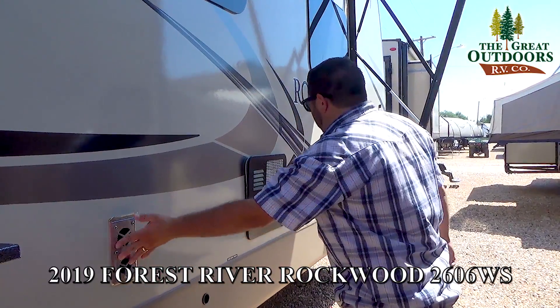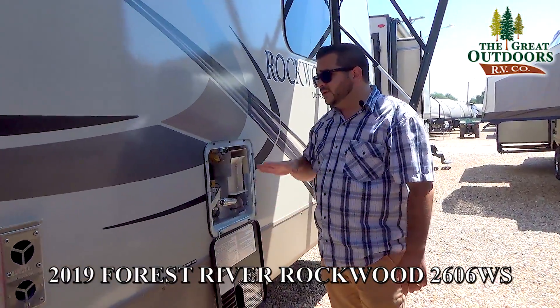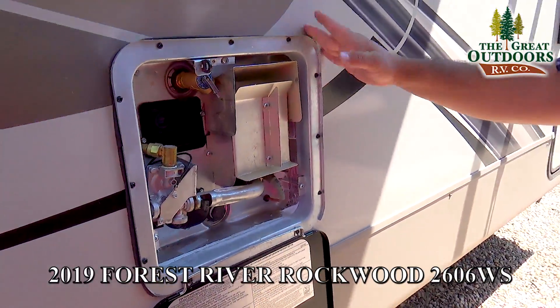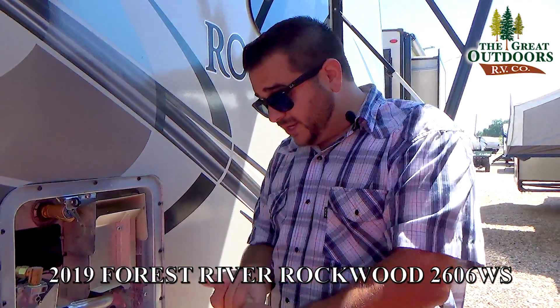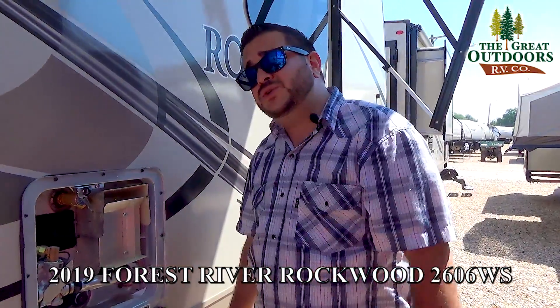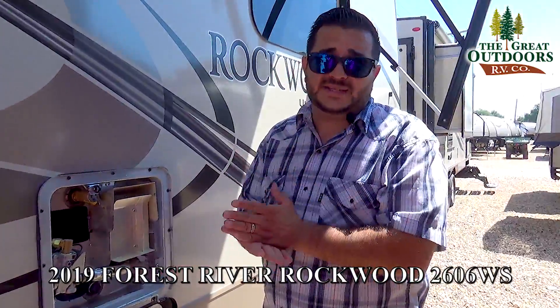This is your Suburban exhaust and here we have a six gallon water heater. This is DSI — I go inside, I turn that on and it starts heating when I am hooked up to electric too, because I have both of those options. I can do 16.2 gallons of hot water an hour as a recovery rate, so everybody gets that warm shower.